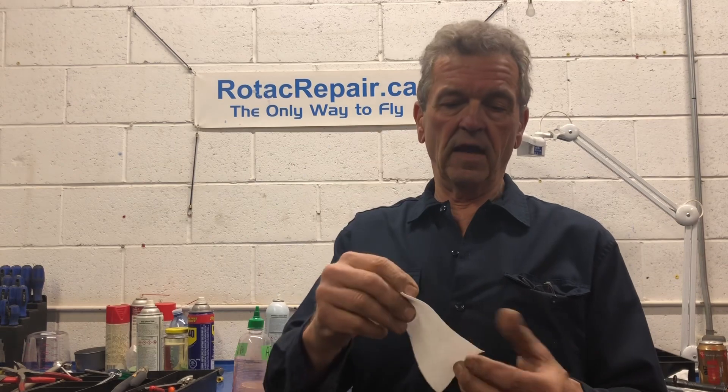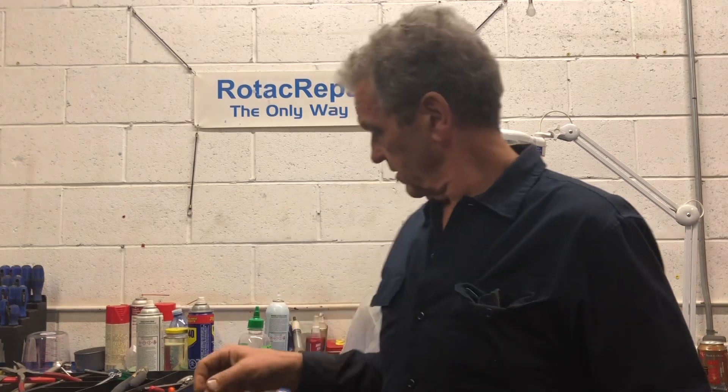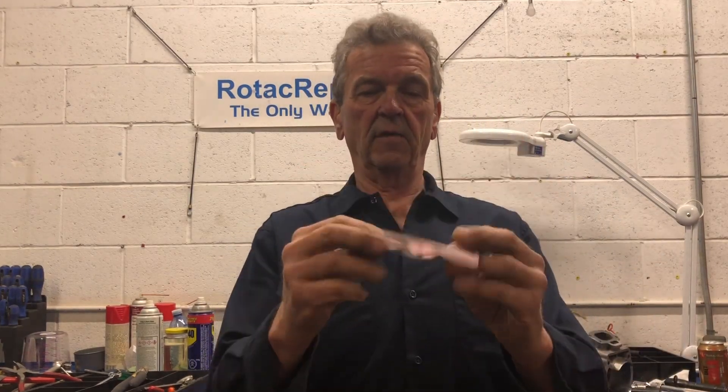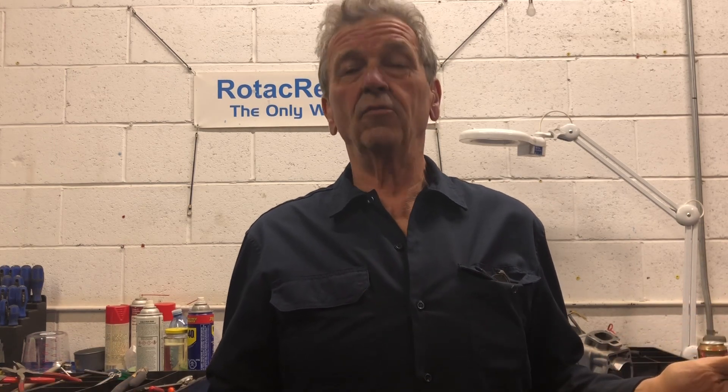This is the one I used and finished up with, and I'll use this for the next oily one — I won't throw this out, I'll recycle it. You keep going until they come out clean — that's the way to do it. Why have all of that grit in the engine? You didn't even know it was there, but you can make it much cleaner. If you're ever honing your cylinders, or know somebody that's honing theirs, try this and see what results they get. I'm sure they're going to get a lot of grit off.